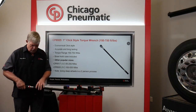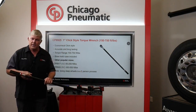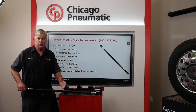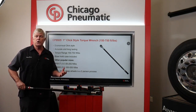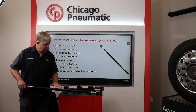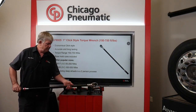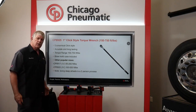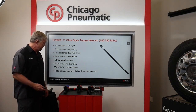When using a torque wrench, you really should be pressing down. Some people will hold the extension — that's a back tweaker. Because not only are you doing steer tires, you're doing deep wheels, oftentimes you need an extension and it's a two-person process. In the next torque wrenches I'm going to talk about, we show how they can be a one-person process. If you're getting into a torquing procedure, normally going to a manual torque wrench is what a fleet or a commercial tire shop will do first — very economical, with replaceable head kits. Our 8917 is a half-inch that goes up to 250 and our 8920 is a three-quarter that goes up to 550 foot-pounds.